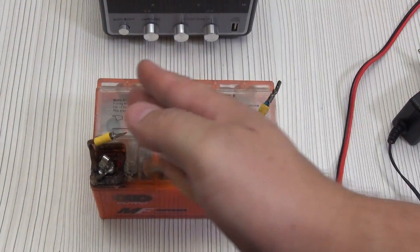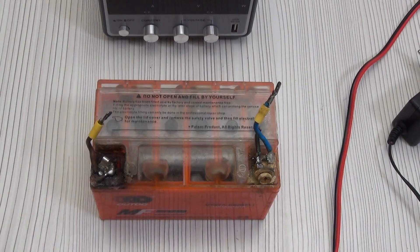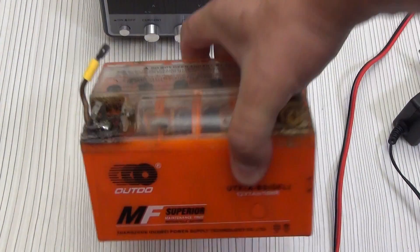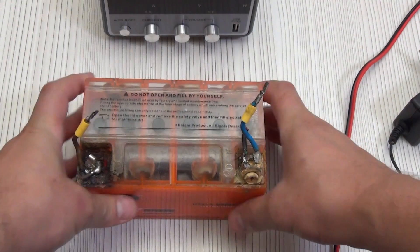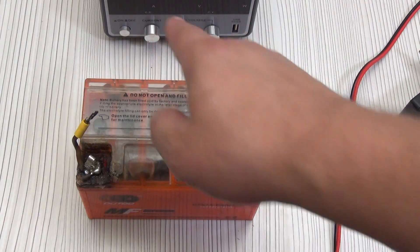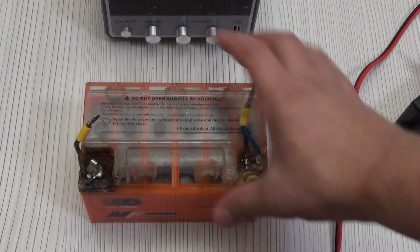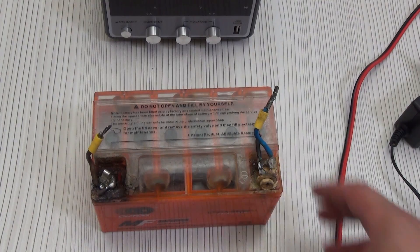And probably the most vital moment if you are a car owner: more than once someone has encountered a dead battery — they forgot to turn off the headlights, the radio, or the battery is old. We check and it turns out to be 12 volts, 7 ampere-hours. Accordingly, we need to charge it at one-tenth that value. We set 13.4 volts and set the current — divide by 10. In this case it will be 0.7 amperes; if there are 60 ampere-hours, we set 6 amperes. After 5 or 6 hours we will have a fully charged battery, and we will be able to start the car.